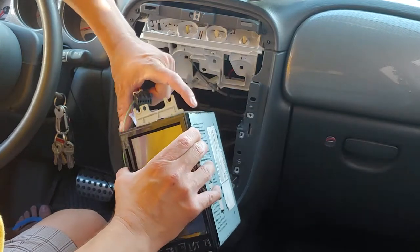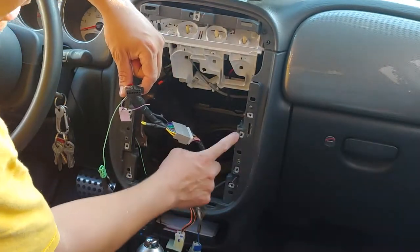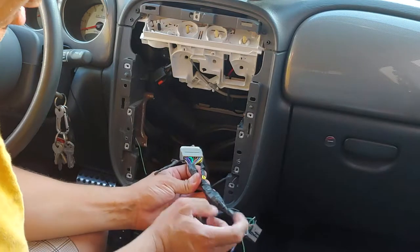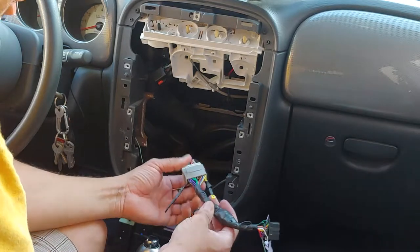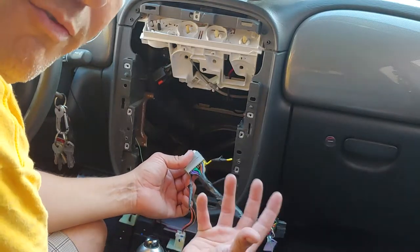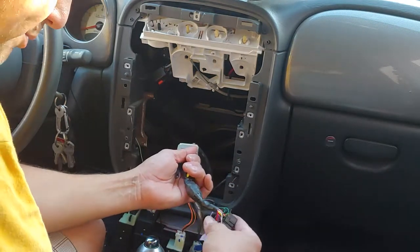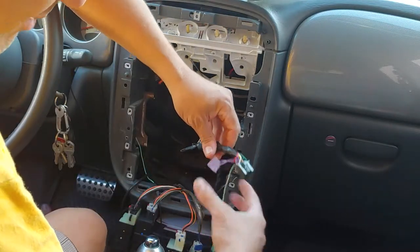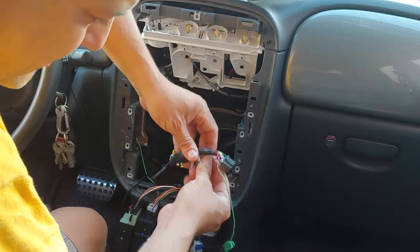You can certainly go out and get a wider one — an actual one you can use for the 06 PT Cruiser double din version — and it'll fit the actual space. In this case they're a little shorter, so you'll see what I did. I wired everything up — here's my harness, my wiring harness to my car. I have an extra power and an extra ground in case I wanted to wire up a subwoofer in the future. I wired everything except the purple one, which is for the reverse gear signal input — I'm not going to use that. That one is for the backup camera — I left it loose in case I want to install one later.